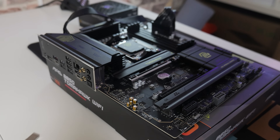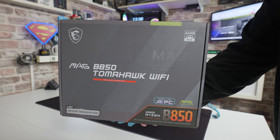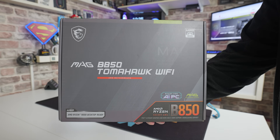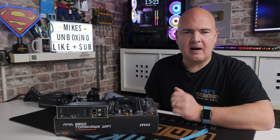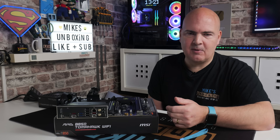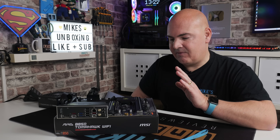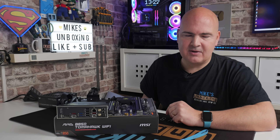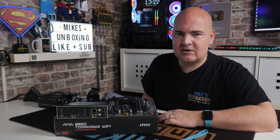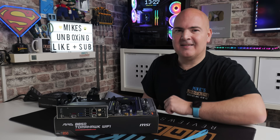That is how to flash the BIOS on the new MSI B850 Tomahawk Wi-Fi with its new 64-megabyte flash, which takes even longer — it's closer to 10 or 11 minutes. So if yours is flashing past the five or six minute mark, that is to be expected with this bigger file size. If you've got any problems or your board is still getting issues, please feel free to reach out to us on the Discord. If you've enjoyed this video, smash the like button. Consider hitting Subscribe and the notification bell. For now, I've been Mike — this is Mike's Unboxing Reviews and How To. Hopefully we'll catch you in the very next video. Thanks for watching.